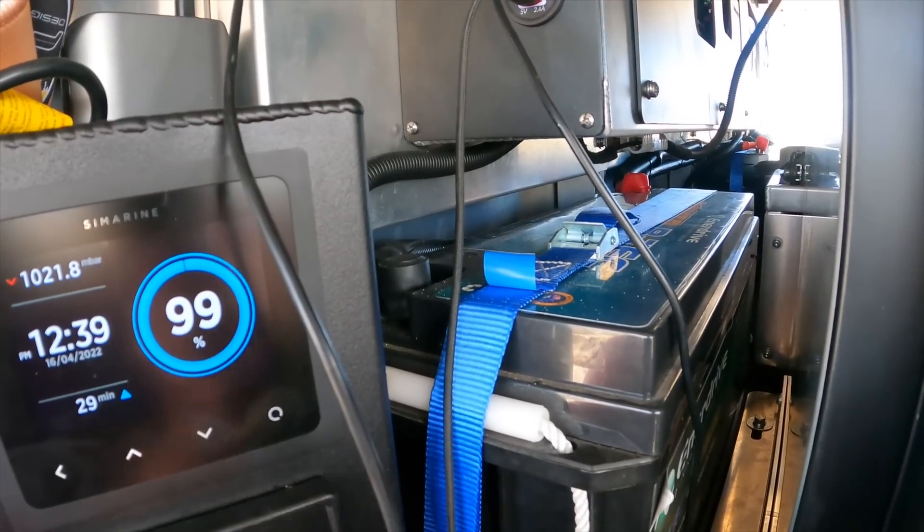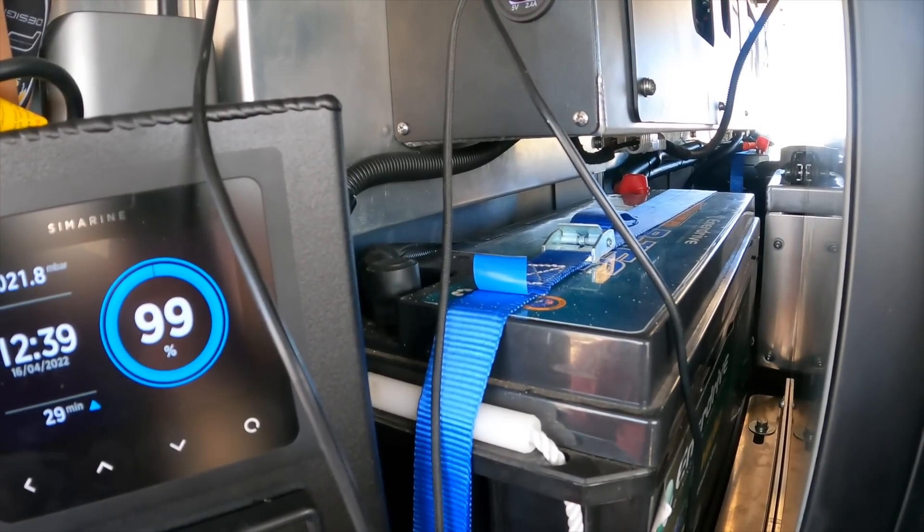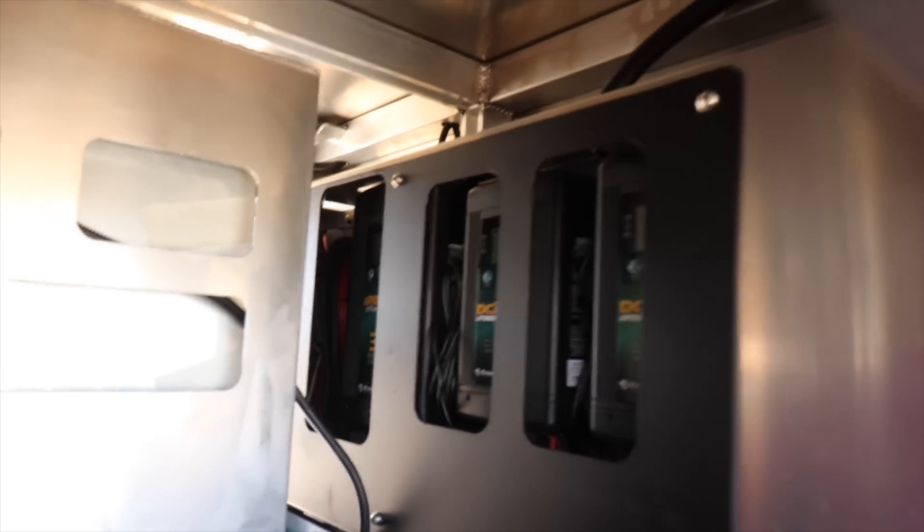So how much battery power have I got? I've got 400 amps of lithium - the BTEC batteries from Enerdrive. I'm running two of them, wired up together for a total of 400 amps. I've got two DC to DCs: the main one feeding from solar, and the way Dan wired them at MITS 4x4, one is handling solar partly and the other is purely car-related - configured to get the maximum current into the system.